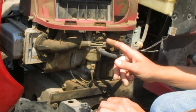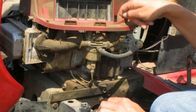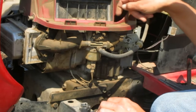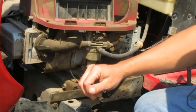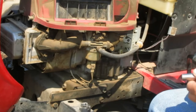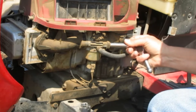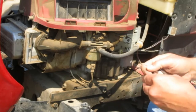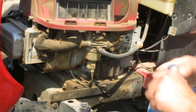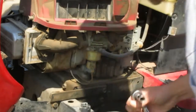Another reason I was thinking the carburetor was the issue is because I looked down here at the actual intake and there was gasoline just puddled in there — that was another reason to believe the carburetor needed to be replaced. The nuts are seven-sixteenths, so this is a non-metric lawnmower — pretty interesting.